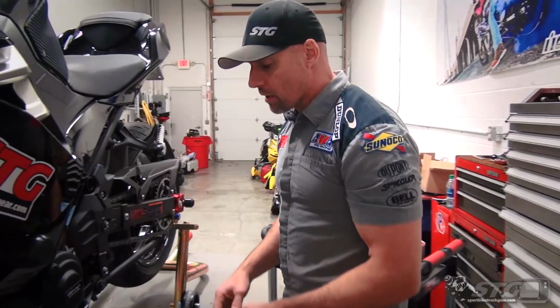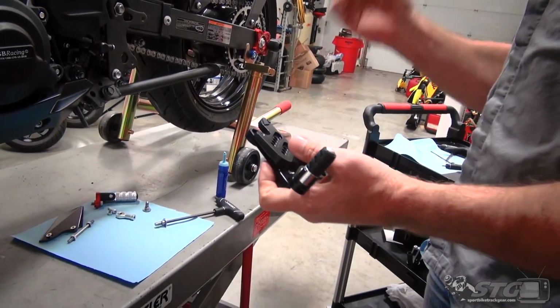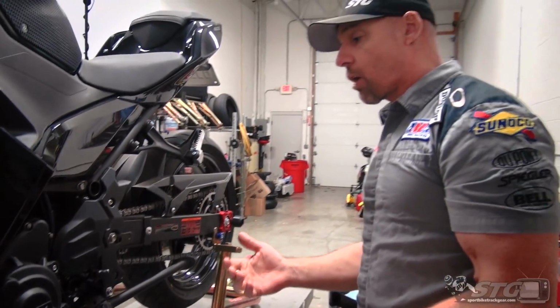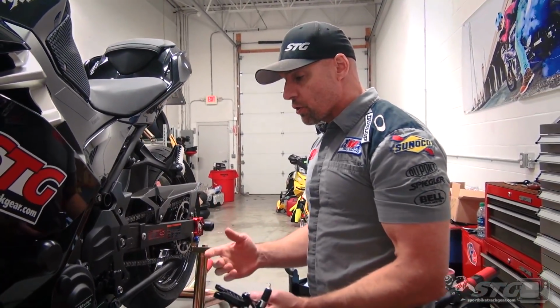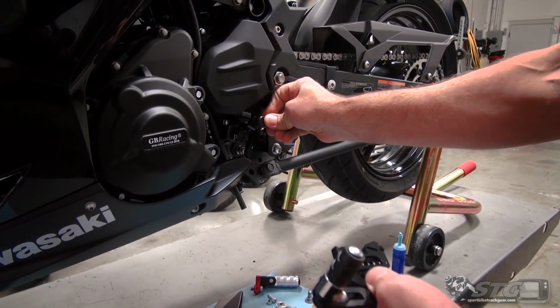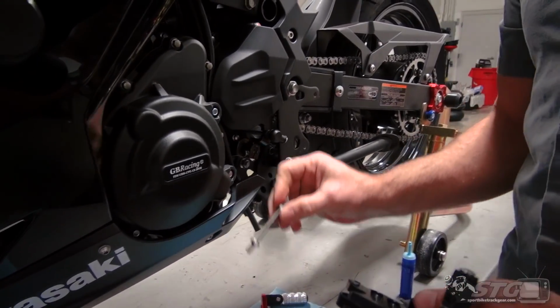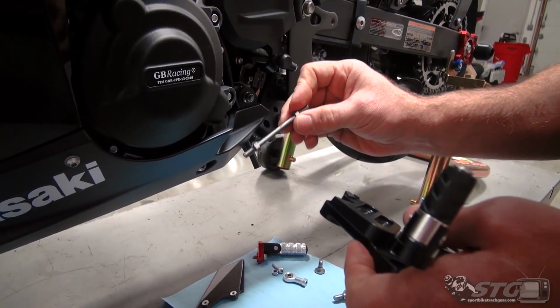Now we're on to the shift side. This kit is able to function in either reverse or standard shift. I'm going to go ahead and set it up right now in reverse shift. You're going to reuse the OEM shift knuckle. The Heim joint is fixed on the shift knuckle up here from the factory. You're also going to reuse the OE shift rod with the LighTech kit.